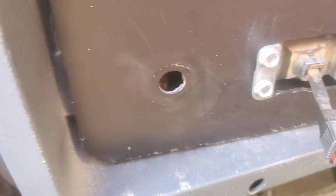In this little hole in the dash I'm going to put a toggle switch. That toggle switch will allow me to bypass everything — it'll be powered from the battery and go over and turn on a relay to turn on the rest of the relays. That way I can turn on the headlights during the day, or if that photo cell switch messes up, I still make sure I have headlights.